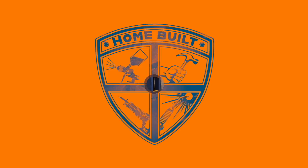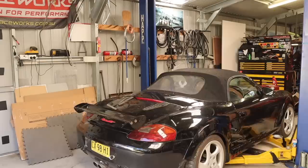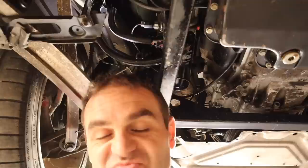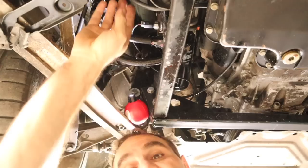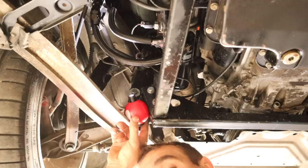Let's get the car back up on the hoist, fit this olive, make sure everything underneath is good, and then later we'll get onto that overheating issue. The olive is in the power steering now. It looks like I made it on the fly without actually looking at the old one and it's probably a little bit too small - I probably need to make it a little bit bigger again. We'll see whether that seals or not. Now I'm having a quick look at the oil leaks up near the oil cooler and the associated lines. One thing one of you guys actually sent me is his invention - a squash light.